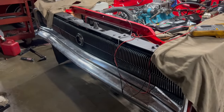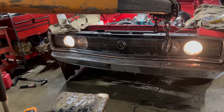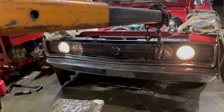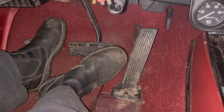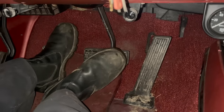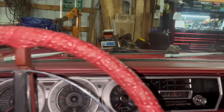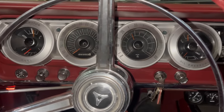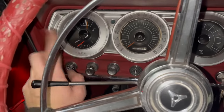You said the headlights rotate but they don't. Motors work fine, relays clicking, but no power is getting to the headlight motors. Oh well, they're open now. In case you were curious, the brakes are perfect — super firm now. But do the wipers work? No, they don't. At least the tach does. The temperature gauge works too. The oil gauge isn't connected, but the fuel gauge should work. Headlights need some aiming.